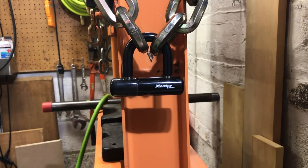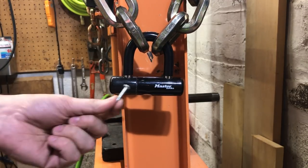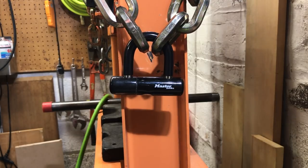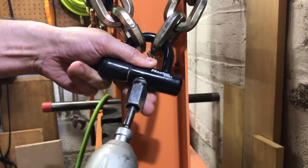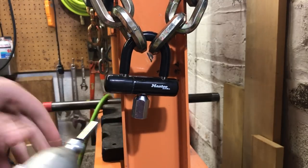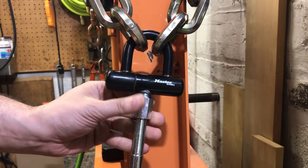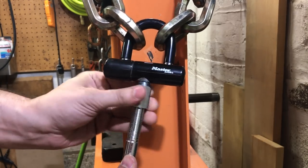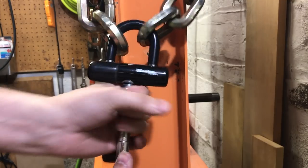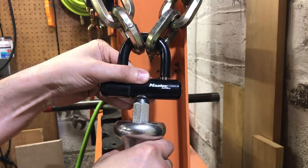So that's what we're going to do right now. We are going to screw this right into the keyway of this Masterlock using a number 10 sheet metal screw. After that you can apply a pulling impact force to whatever you have screwed this piece to. Okay, I think we've got that in pretty good. Now I'm going to take my slide hammer rod, thread it on. Okay, that should be more than enough, and then we are going to use this hammer and pull that core right out.